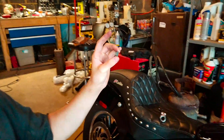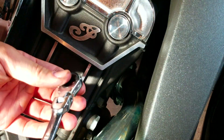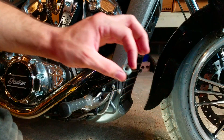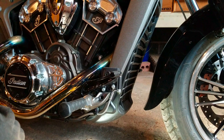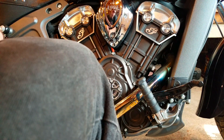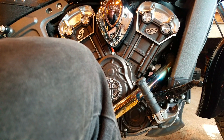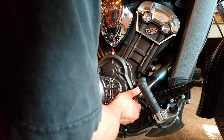Okay, as you can see the header's still on, but I only have one bolt left. The bottom head bolt is done — now I just gotta get to the top. Word to the wise: it's actually a little bit easier if you've got one of these to attack this one from the other side of the bike. Bolt number four is out. However, we still only have three bolts up here on the seat, so I'm fairly certain that bolt came out and went into the belt cover — which could be catastrophic if I were to ride this thing. My dumb ass forgot the O2 sensors — this will do the rear one. I don't think this is a 13mm — 14mm wrench.